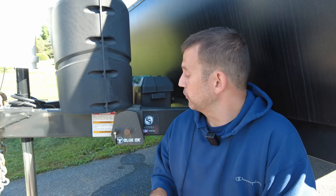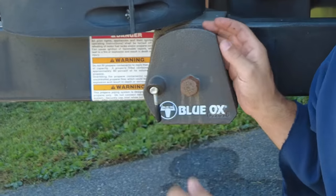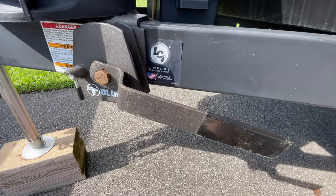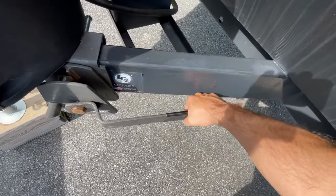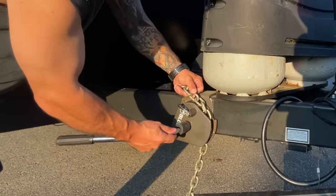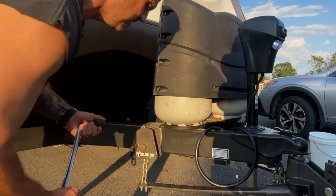This next one is for folks who have the Blue Ox Sway Pro hitch or any hitch with a sliding sway bar locking assembly. The tool they give you to lock in the sway bar is short, and the way it's shaped positions your hand uncomfortably close to the frame. If you don't already carry a breaker bar, it's a good tool to have with you in an RV anyway. I use an angled-head extendable breaker bar with a one-inch impact socket to lock and unlock my sway bars. It spaces the bar and your hand away from the frame — simple physics: the longer the stroke, the less work required.